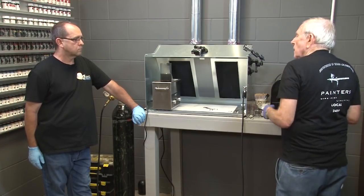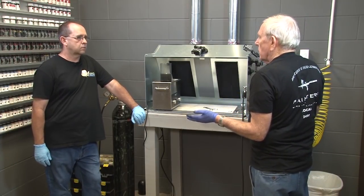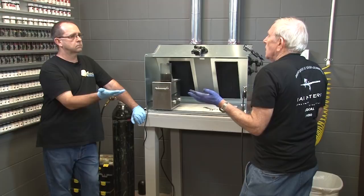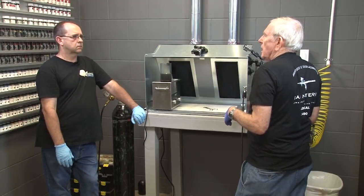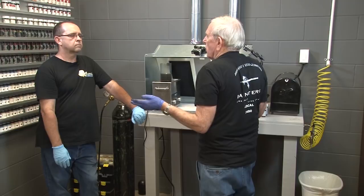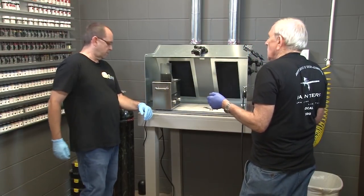I mean, if it's 60 in your garage, it's not going to get as hot. If it's 90 in your garage, it's going to be a little hotter. And now, how long do you leave it in there? So this is the first coat. 30 minutes? No, I leave it in an hour. Sometimes I get busy, I may leave it in there 2 hours. I've gone off to lunch, left it in there for 3 hours. You're not going to hurt the paint. Right, so the idea is we're baking it on. That's exactly what we're doing here.